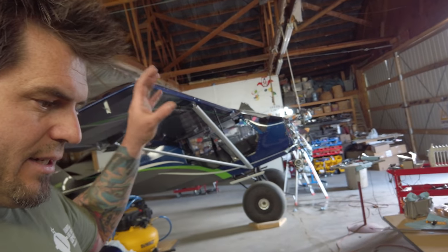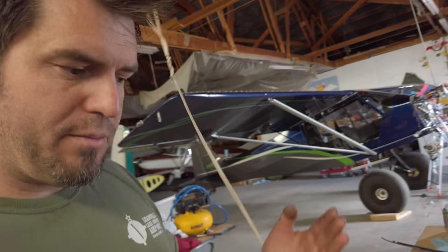And I'll set the tune to where as I go up, I can maintain power as long as the intercooler can handle it. Essentially, that's what I'm going to be tuning around, is intake air temperature. Since I'm not as restricted on what the engine can handle with this new setup, I'll be able to tune more on just safe intake air temperatures with whatever we end up doing for an intercooler setup.